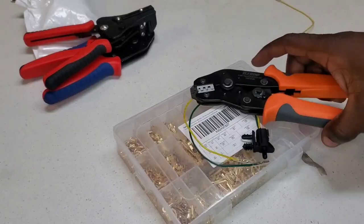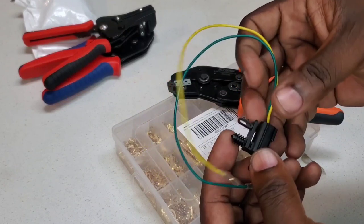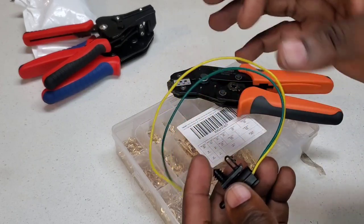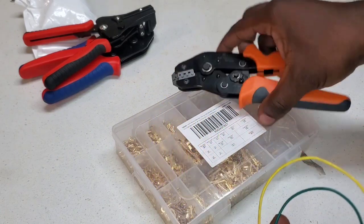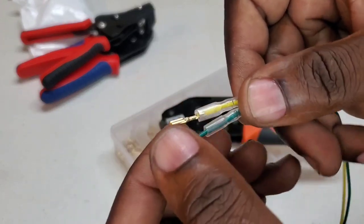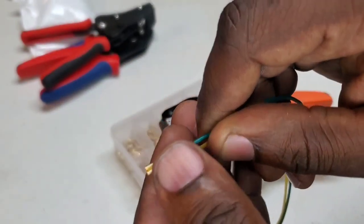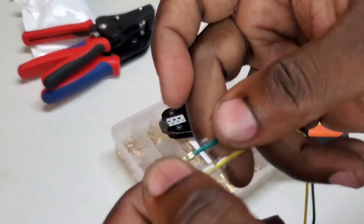Here's what you can do with the right tools and equipment. A customer asked me about an ambient air temperature sensor — he didn't want to wait to order the harness and offered me $100 to create one basically to factory specs. Using this kit and this tool, I was able to do it. Let me bring this in so you can see the crimps — see that level of crimp quality. That is 100% solid, not going anywhere. The wire will rip before those crimps fail.